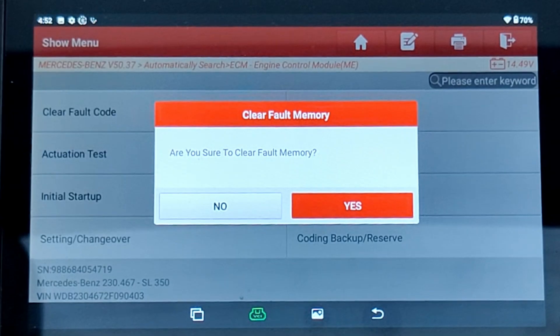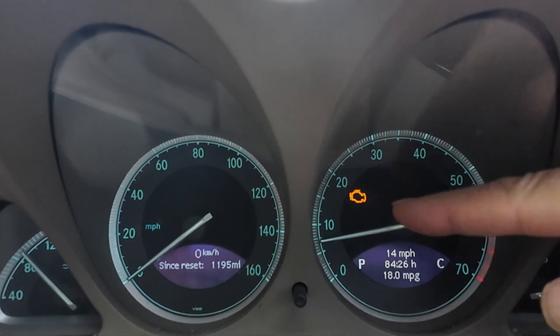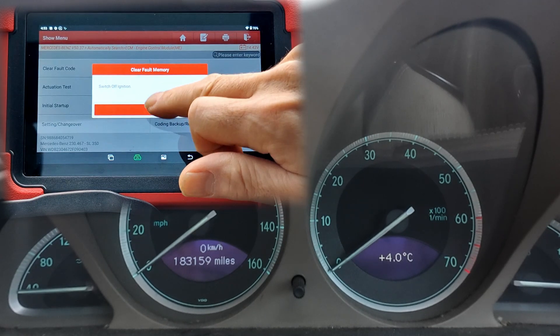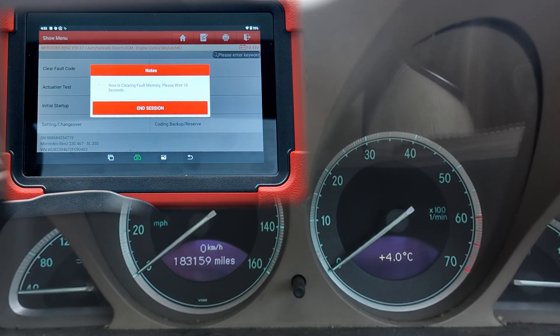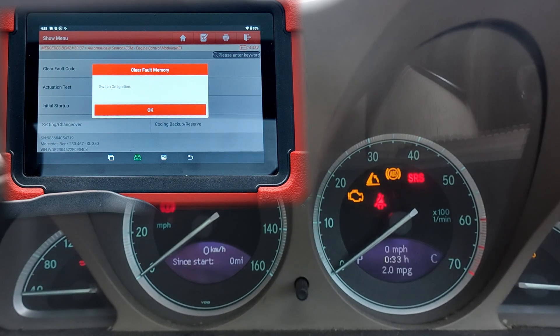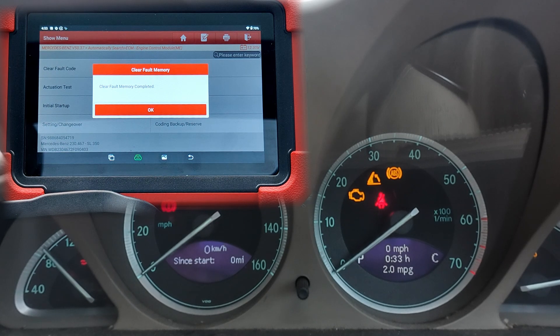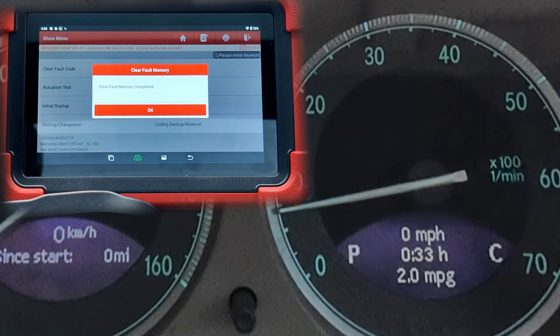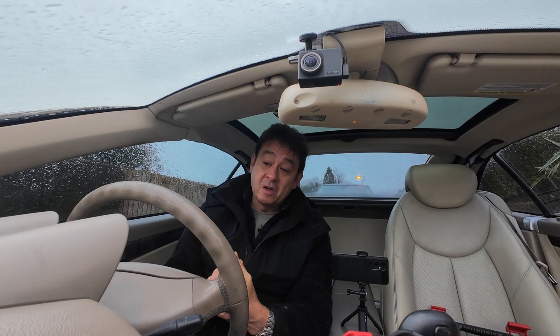Let's try and clear the faults. Let's go into clear fault codes. Are you sure you want to clear the memory? Yes, I absolutely want to clear the fault memory - I'm going to press yes. And if you look at the dashboard, let's hope that this ugly little engine management light disappears. Switch off ignition. Ignition's off. Wait 10 seconds. Some cars you have to do this - Mercedes specifically - but Fiats and Hondas, you can just clear the fault without having to turn the engine off. Switch on ignition - press OK. And it says the clear fault memory is completed. Let's start the car and see. And as you can see, there is no fault code on the dash now. That's not to say it's not going to come back - the weather's been miserable and I've only been doing short journeys. Bottom line is, I've got to get that sensor changed.